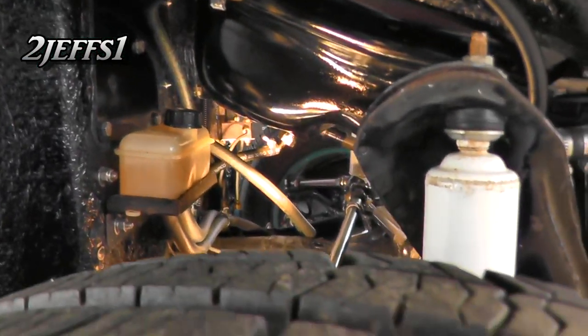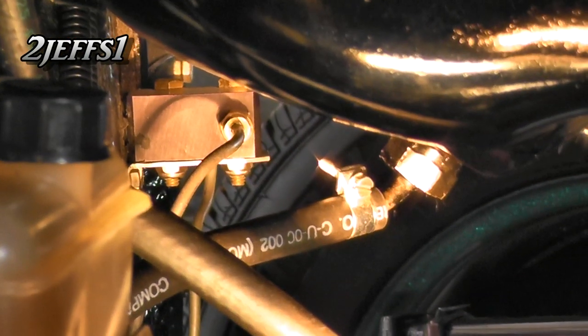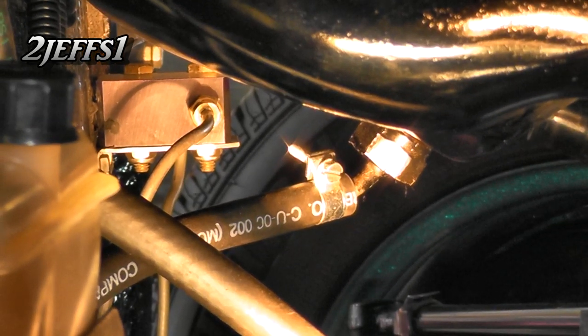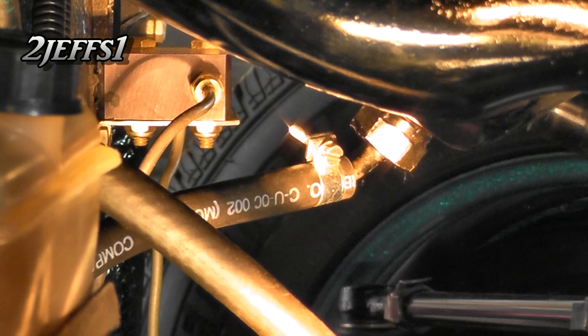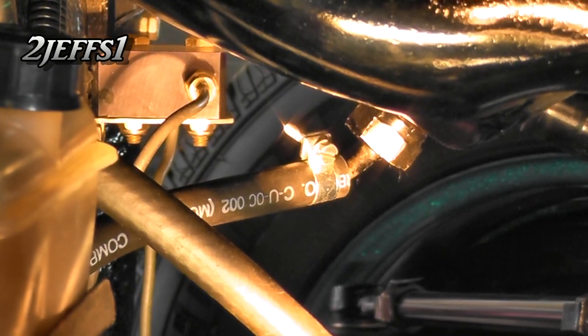What I have here on the fuel tank is where the fitting comes out on the bottom — it's only a quarter inch. What I did was underneath that hose and hose clamp, I soldered on a 5/16ths OD copper tubing onto that to adapt the hose, so it won't crush the hose down to a quarter inch and be a poor fit.